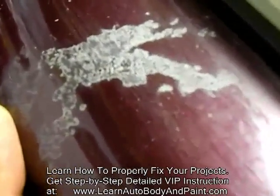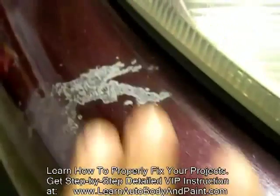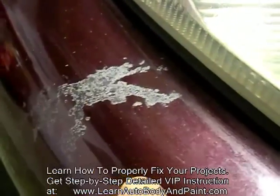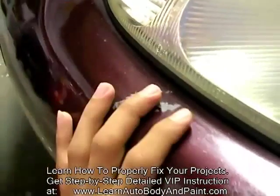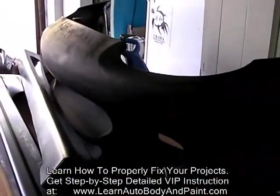The clear is actually eaten up. The proper way to do this is you have to sand it out, feather it, prime it, rebase it, repaint it. But we're not going to be doing that with this car because this whole front clip is going to be for sale — I'm just going to throw it on eBay or sell it locally because we're putting a full Bomex body kit on it. We're going to change the whole front of this car.